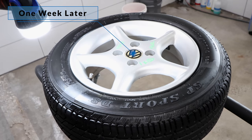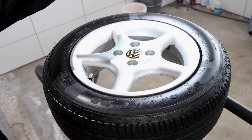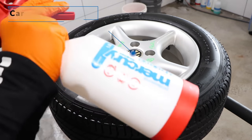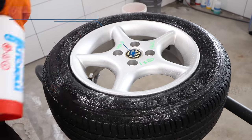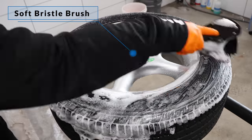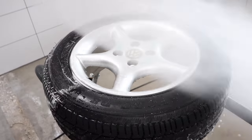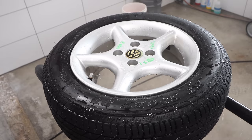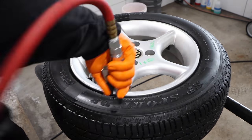The next test was seeing how well Carpro Blackout can resist tyre cleaning chemicals, which may also give us some insight to how long it should last. Now, I wasn't sure at all what to expect as far as chemical resistance goes, so I started a little more gently, firstly using a lighter dilution of an alkaline cleaner with a soft brush to see how it goes. But as you'll see, I then began to use stronger concentrations of my chemicals, and even stronger chemicals, and a more aggressive brush as I continued to see what it would take to remove or at least start to break